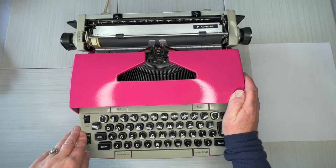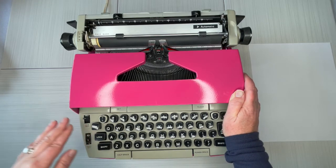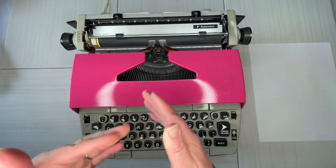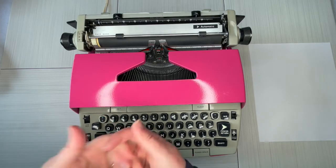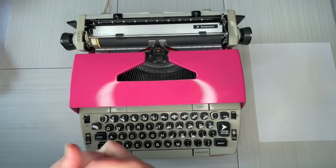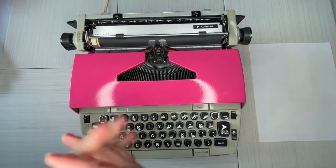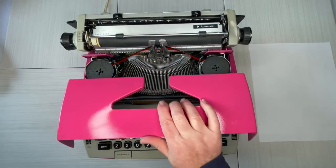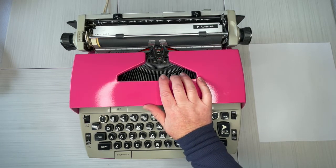When using the universal spools, we have not had any do an auto reverse. So there's no notification. You just have to be aware as you're typing, and it's hard to get into that habit, I'll be honest. So don't panic when your typewriter all of a sudden stops or starts doing something funky. Just reverse the direction of your ribbon. I use these exact ribbons in my own personal typewriter, and I probably reverse the direction 50 times before I even think about changing it out.